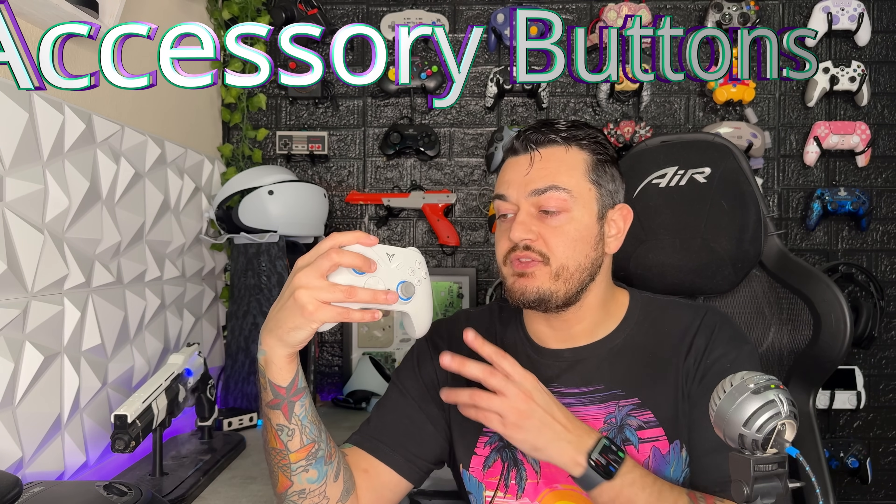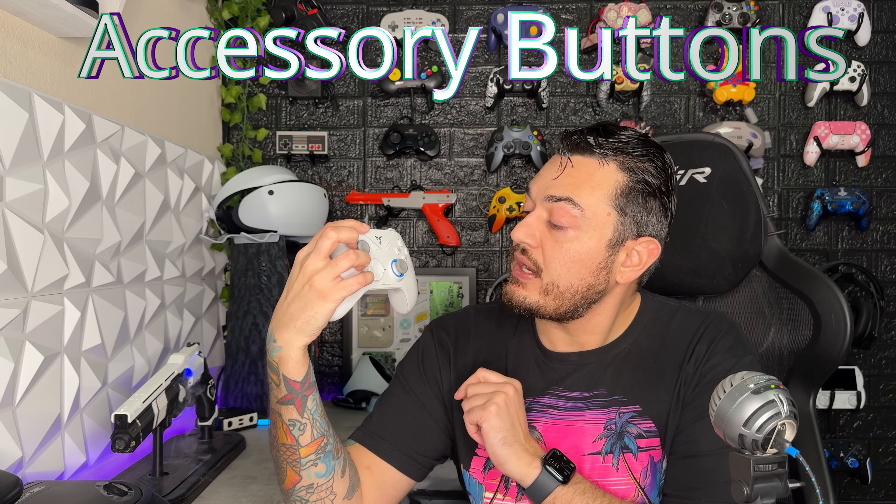These are membrane buttons — it's no big deal. I wouldn't bash the company for including membrane buttons on a $50 controller, or even a $170 controller, since a lot of gamers prefer membrane switches. When you're trying to call it something that it ain't, that tickles my biscuits in the wrong way. As for the accessory button suite — start, select, home, and capture for Nintendo Switch — I have no qualms with start and select. They're at a 45-degree angle and oval-shaped, but they're pretty easy to hit and feel really nice, tactile and clicky.